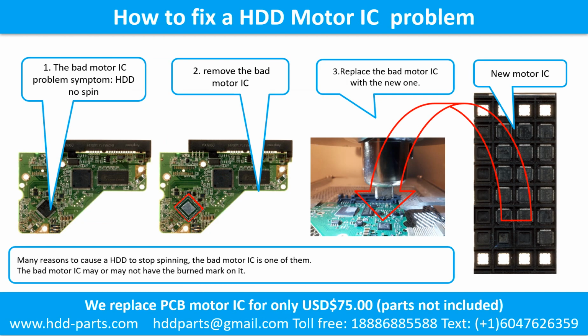How to fix a hard drive motor IC problem. 1. The bad motor IC problem symptom. The hard drive does not spin. There are many reasons that can cause a hard drive to stop spinning. The bad motor IC is one of them. The bad motor IC may or may not have a burned mark on it.